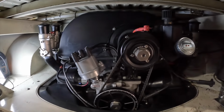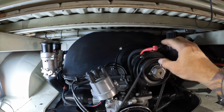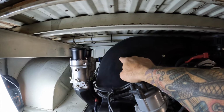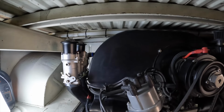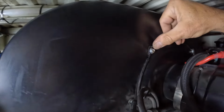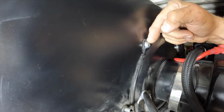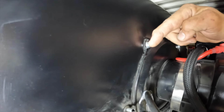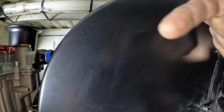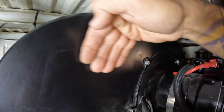Our next order of business is we're going to be taking those two top bolts off there and getting our linkage bar mounted up there. We have to cut the third hole into it, and I'm going to use a nut rivet to do that. Something you need to pay attention to is you want the back bar to be straight. There's obviously a distance here because of the way that shroud piece is, and you'll put a couple of Berg washers in there to stack it out on each one of these. So when we get our nut rivet in here, we're going to have to have a washer in between the bar and our nut rivet to give it the same spacing all the way across to keep that bar nice and straight.